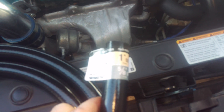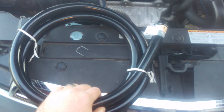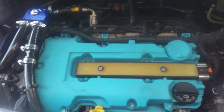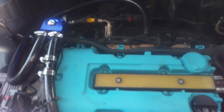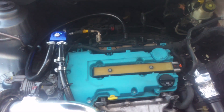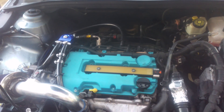It's one inch outside diameter, five-eighths inch inside diameter. You have to use some really rigid hose — if you go get some flexible vacuum hose from a parts store, it's going to collapse on you. So you have to use very rigid hose to handle the vacuum pressure.